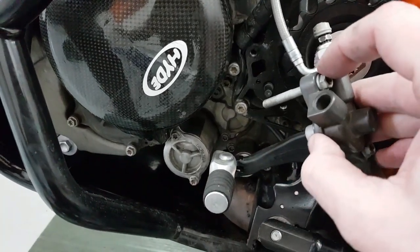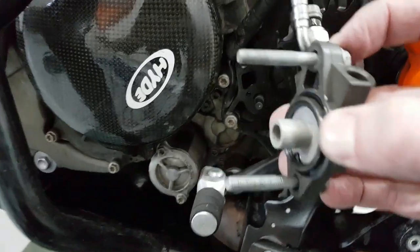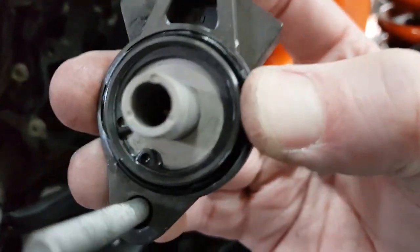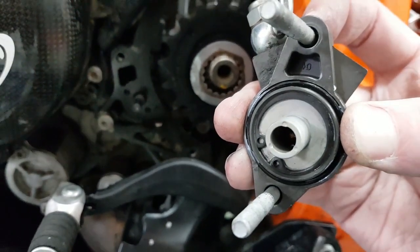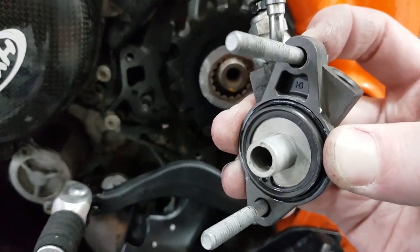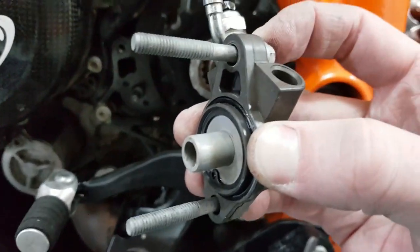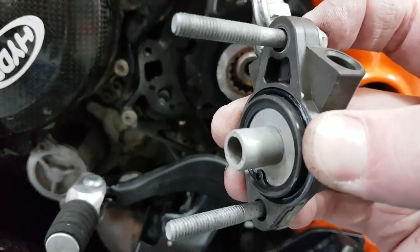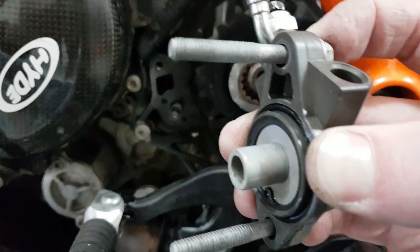Okay, I'm going to put the clutch cylinder back. Gentlemen, if you're doing this, the longer bolt is at the bottom. O-rings, always make sure they're greased up a little. In here is a little steel ball. It may rust, so squirt a little bit of brake cleaner in there and then add some grease. Just a little bit, you don't want to overdo it. Also, if there's oil around this tower or cylinder, whatever you call it, don't worry about it. It's normal. There's no leak yet.